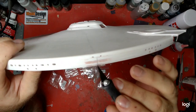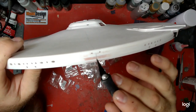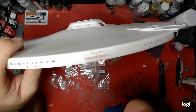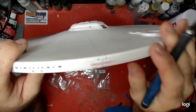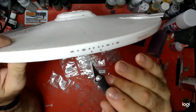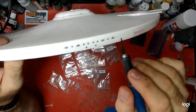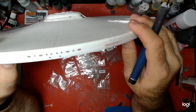If anything, what's going to cause me a problem is where these pieces join together, because I definitely have to re-etch those. And so far I have not had great luck making them look perfect. Because if they don't look perfect, I don't want a nice sensor band and all of a sudden there's a little pop there and you can tell where the joints are. If I can't do it without getting rid of the joints, then I'll probably go Boyd's method and just fill them in and then come back with some high build primer and just remake these ridges and then use decal on the inside.